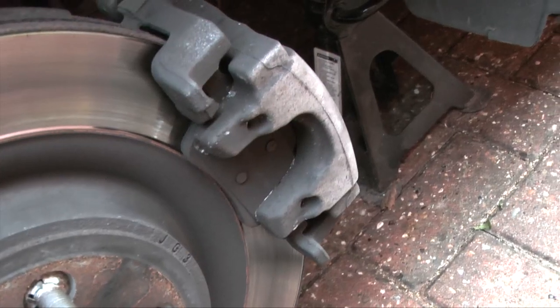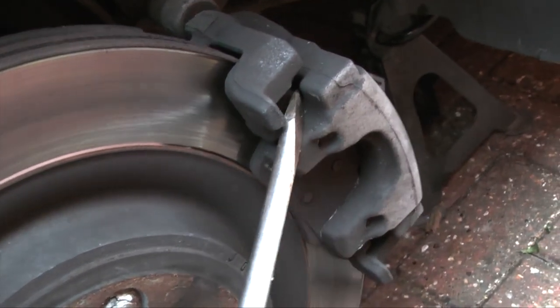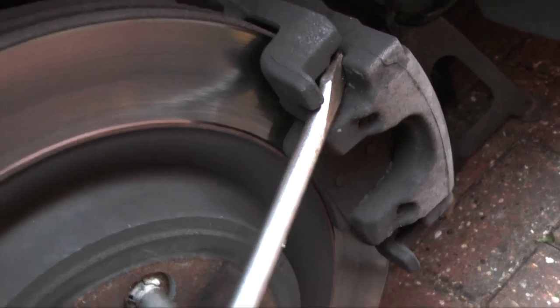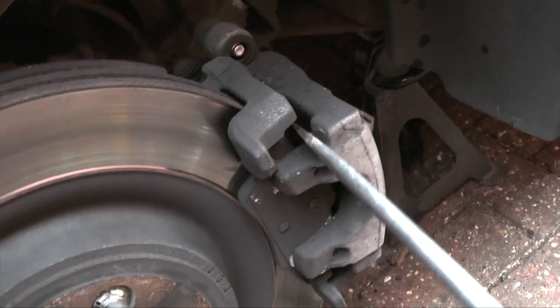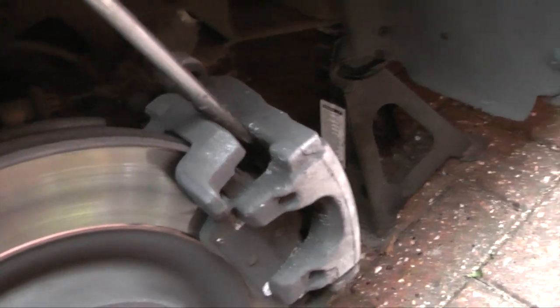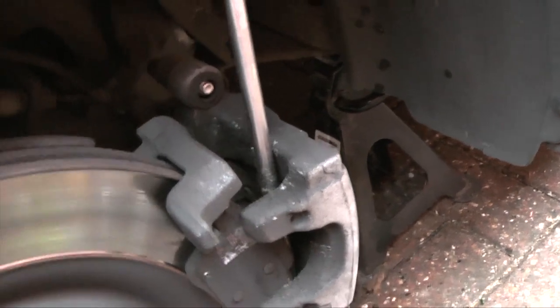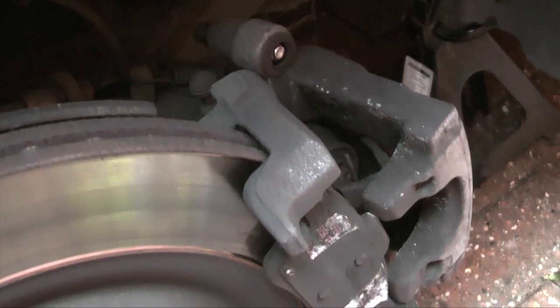New wear sensors are about 5 or 6 quid on eBay. The caliper will be a little bit stuck, but a good place to put your screwdriver is here to give it a little wiggle and then the caliper will come off. Take care not to damage the brake line and support the caliper on the park brake assembly out of the way.